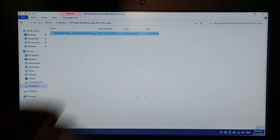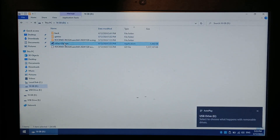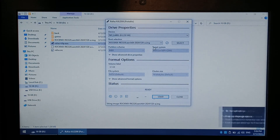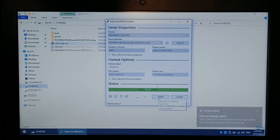Now we want to insert our fresh SD card into our SD reader. This isn't the SD card that came with the R36S — I'm keeping that as a backup, since you will lose all the files on the SD card when writing the new image. Go back to the Downloads folder and double-click on Rufus. Make sure you have the correct drive selected — at the very top it says Device. Mine is a 32GB microSD, E-Drive. Where it says Disk or ISO image, keep it as that. On the right of that, click Select and navigate to the download location, open the folder, and select the image file we extracted — around 2 gig. Leave everything else as default and click Start, click OK. You will lose all files on this SD card. Once it's finished, click Close.